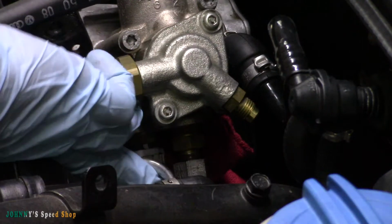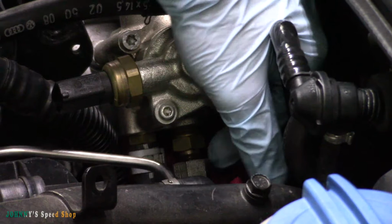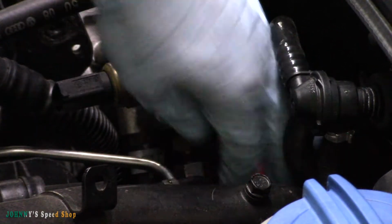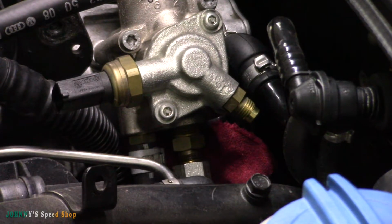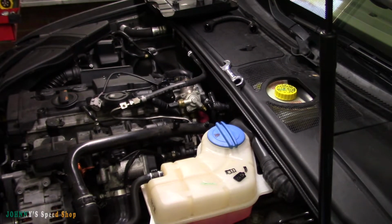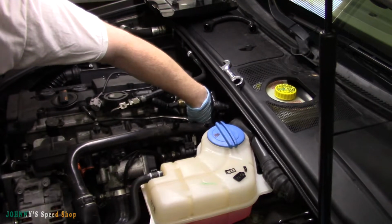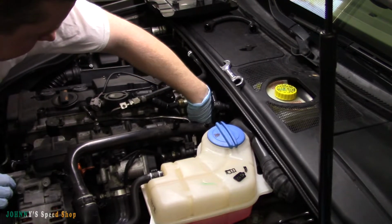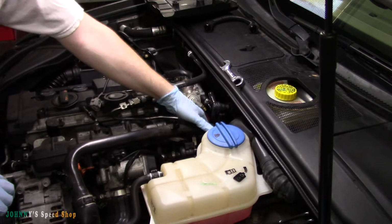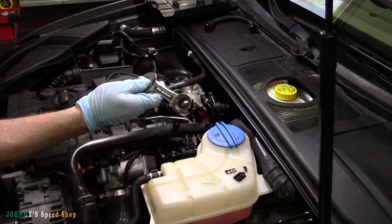Yeah, look right here. This is the fuel line in. It's stopped hissing. It's gurgling a little bit. Once you crack these, you can spin them off just with your fingers. It's pretty easy. And that's it, it's broke free there. So it's a 17 mil. Get a stubby so you can get in there.